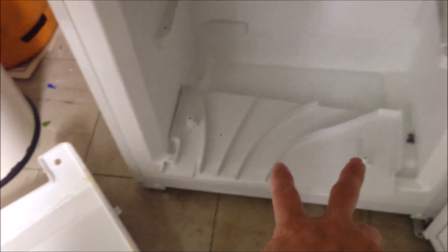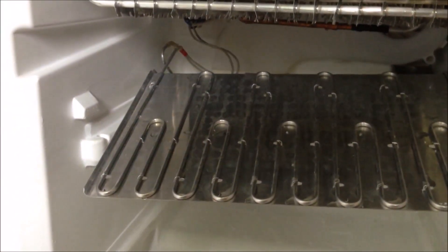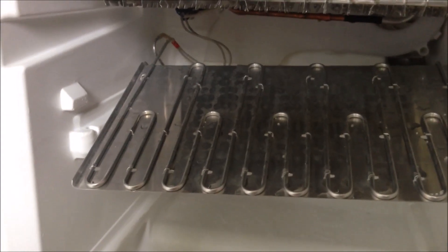You don't have to remove the top cover. If you wait for a longer time — like two or three days — I think that will do the job. I removed the cover just because I didn't want to wait too long. I removed the cover with just two screws for the lower cover and two screws for the upper cover. But if you don't mind, you can just wait two or three days and all the ice will be melted down.